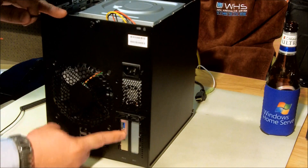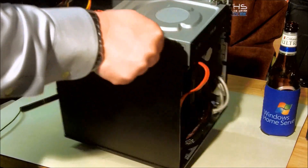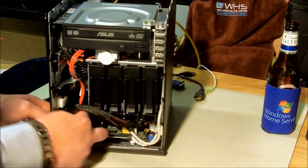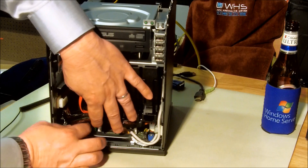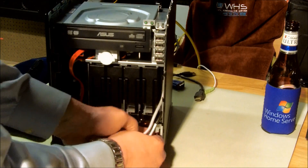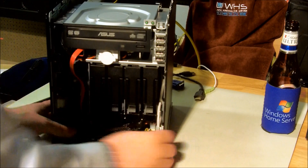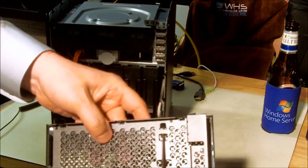In the back, you can see I now have my two USB 3 ports. Everything else works and is good to go. Let's turn it back around. I want to line my cables back up — my three cables go back on this side, pop them back into their little clip, then go through and put the screws back on. You can use a regular screwdriver, your fingers, or whatever you want. I'm going to get the motherboard tied back down. I should keep the cables off and secure the motherboard this way first. Everything is back in — cable one, cable two, and cable three all set.